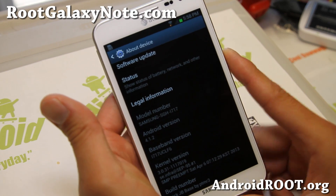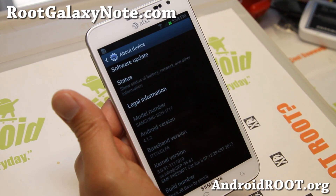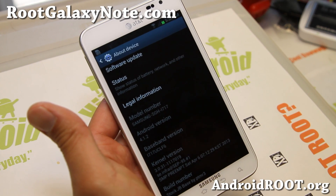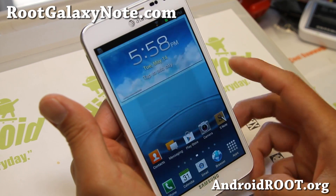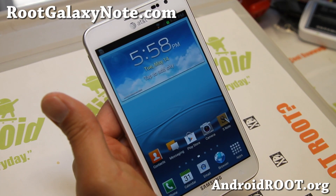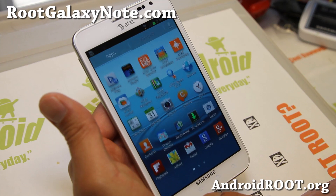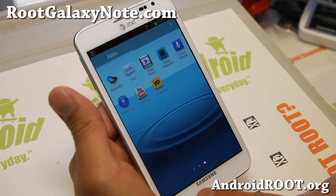It's Android 4.1.2. There are a couple different versions. The easiest version is to flash the stock Jelly Bean base by PTMR3. This is basically a stock ROM you can flash with your TWRP Recovery or ClockworkMod Recovery — it's just a zip file you can install. This one does come with root, so you don't have to re-root it.